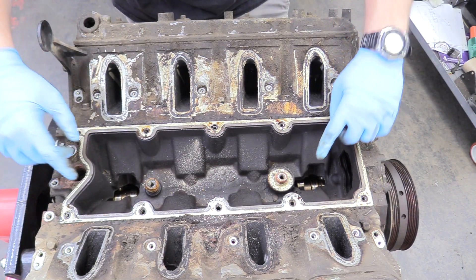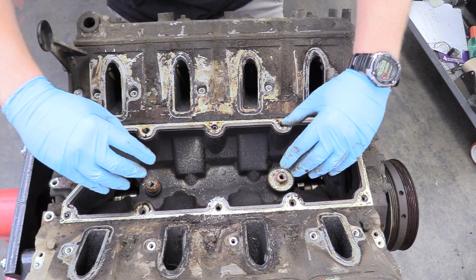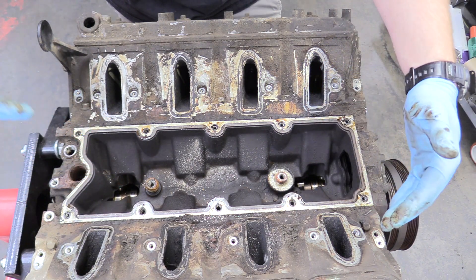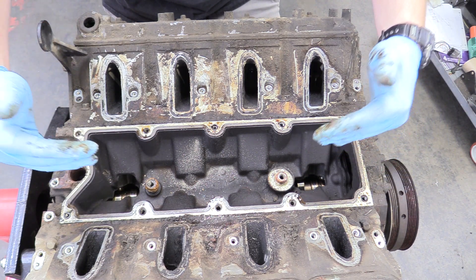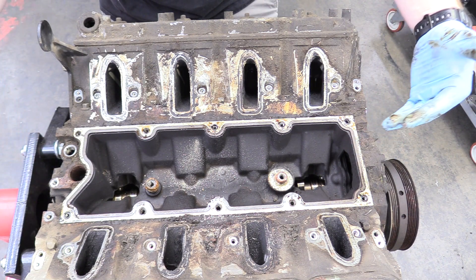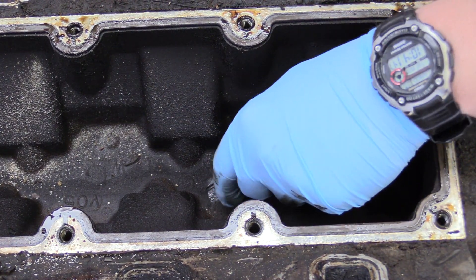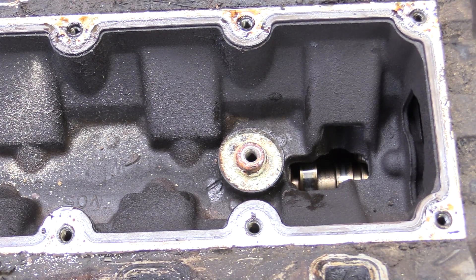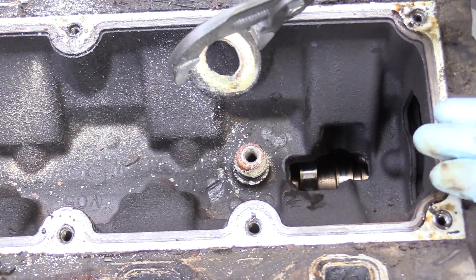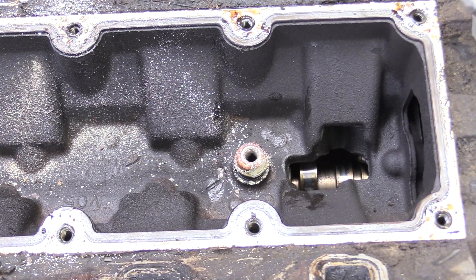Set that aside — we will need this later. You can see this is where GM put the knock sensors, and it's actually a really good place for them. Think of them as little microphones: if they're nice and deep in the engine and very close to the cylinders where ping might happen, they can hear it very easily. They used to be located on the outside but it was discovered this was a much better and more ideal setup — a little bit of a pain to change one, but overall a better design. One of the seals didn't come off with the lifter valley plate, so we'll grab some channel locks and work it off. Don't worry too much about getting crud inside the engine — this whole thing is going to be hot tanked later.